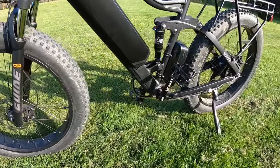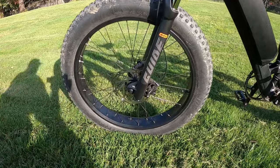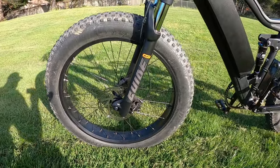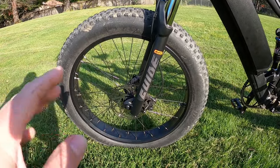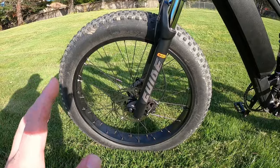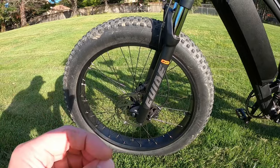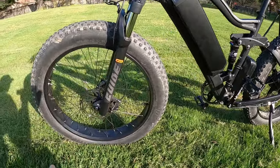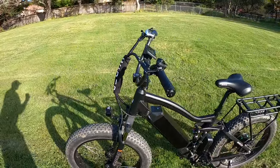One of the things I didn't like very much was how much squeaking I was getting from the front and rear rotors. I tried cleaning them with rubbing alcohol but didn't have much success — they were still squeaking. So I removed the rotors, sanded them down, and sanded the pads as well to get rid of any oil, contamination, or debris. Check the video on my homepage if you're interested. The squeaking is completely gone since then and the brakes work really well.